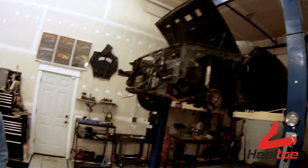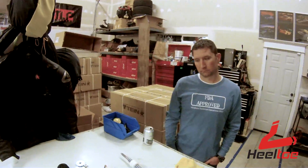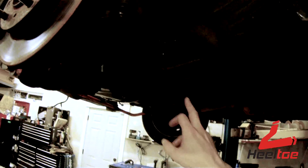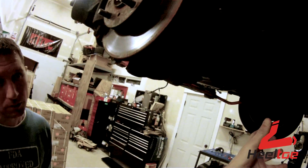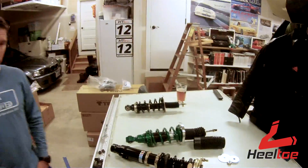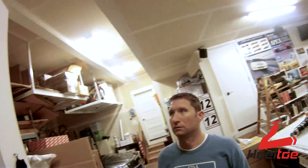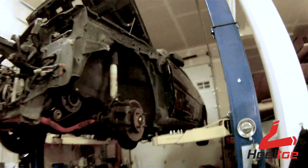One of the things that myself and others in the community surrounding this car have been concerned about is load bearing. When I put the car on the ground and the torsion bar is acting, the force is carried through the torsion tube, it twists, and this reinforced area of the car is meant to bear the load of the spring — it's all part of the subframe. But when you put a coilover arrangement on, the load is all being borne by the strut mount up there. The prevailing argument against this setup has always been that the car was never designed to have the weight carried up there.